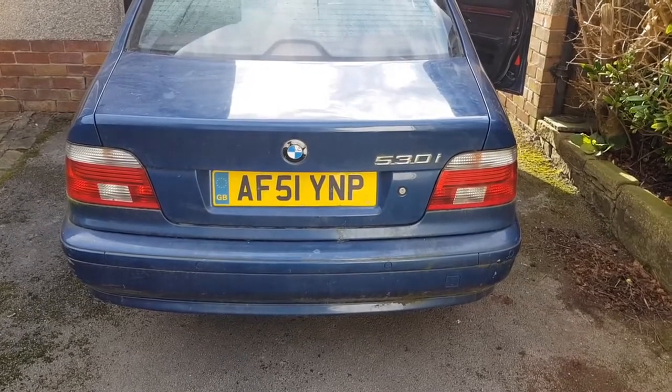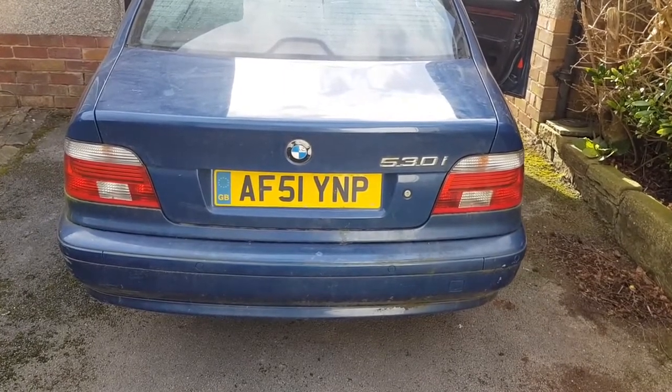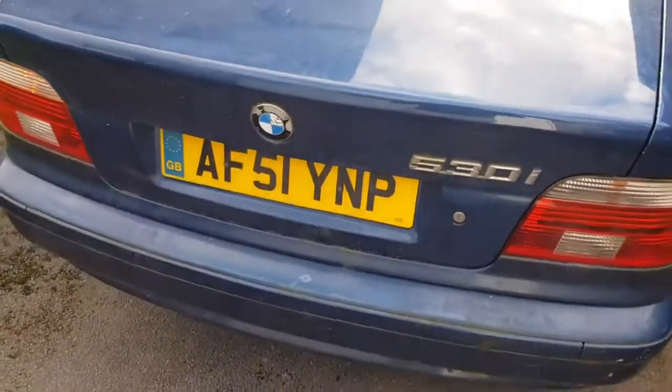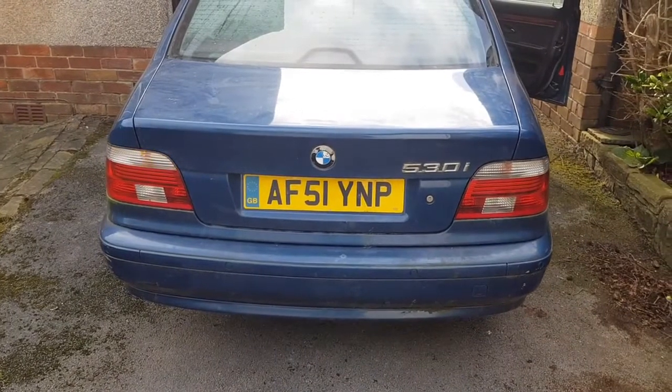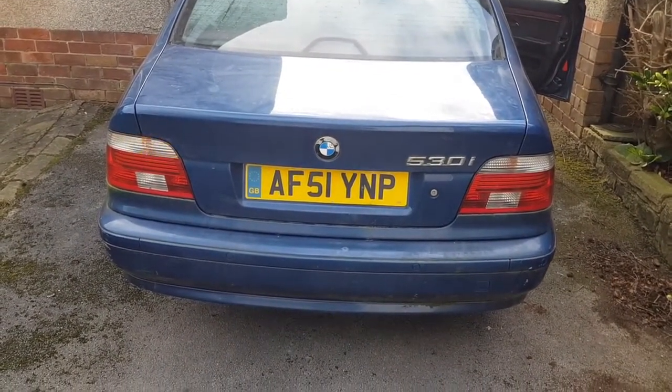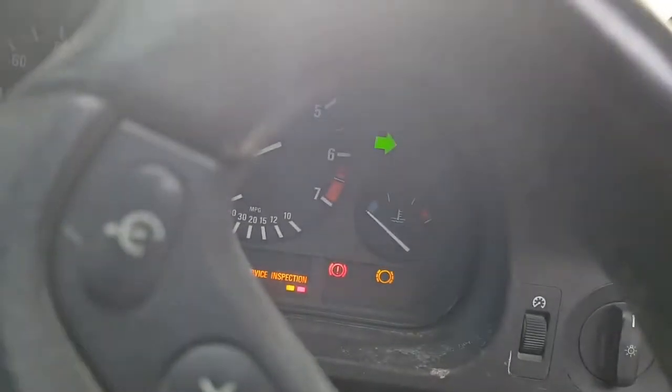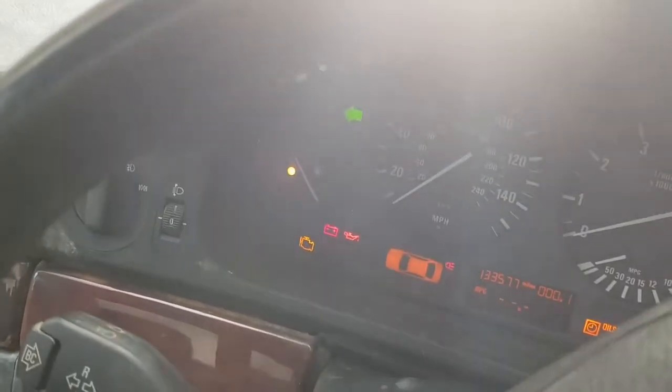So the quickest way to illustrate the faulty indicator is to turn the warning lights on there, and as you can see, just the left hand side indicator is activating, even though all these bulbs were changed yesterday. On the dashboard, both the lights are synchronous, but if you change to the indicator, then the one on the right is blinking at twice the rate of the one on the left.